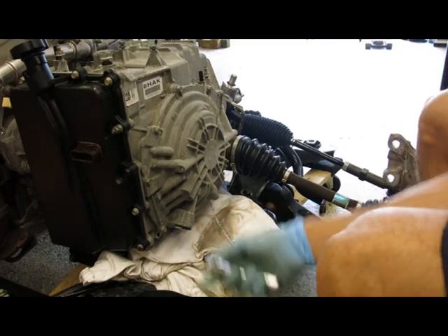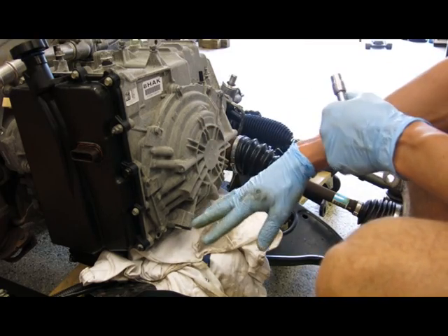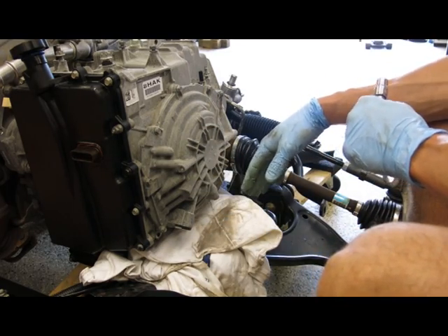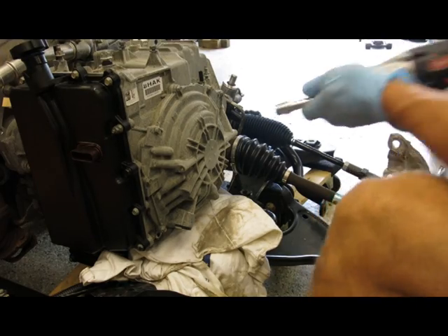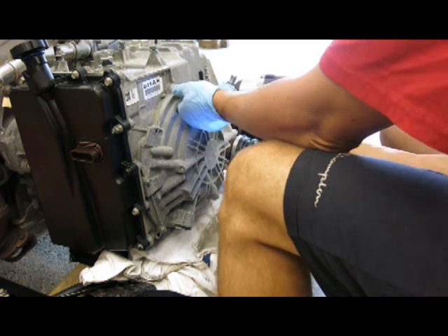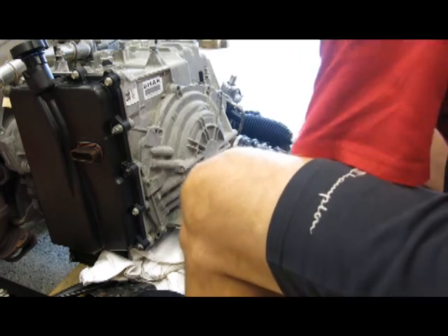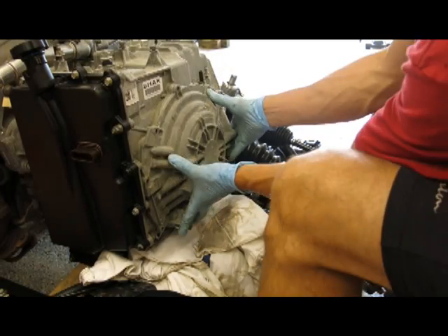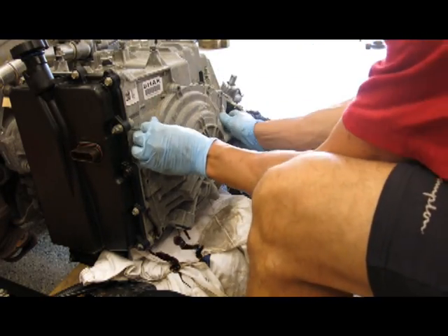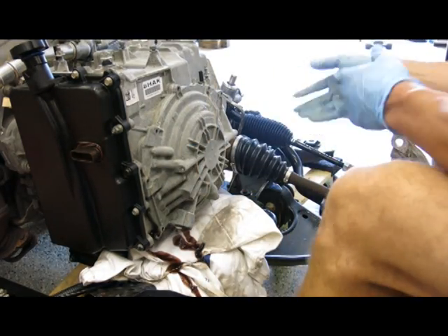Before I got started, I already drained the fluid, but since I'm sure there's still going to be some left in there, and given all the cleaning I've done to this assembly, I put a rag down to pick up any more fluid that falls out. There are a whole bunch of 10 millimeter bolts to take out. There's a dowel pin there that looks a little rusted — it's probably a little stuck, so I'll loosen that up.